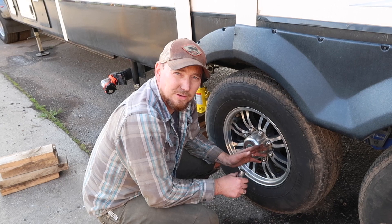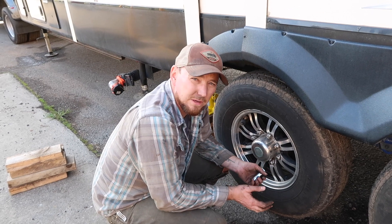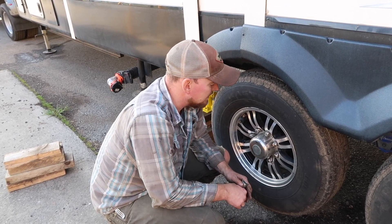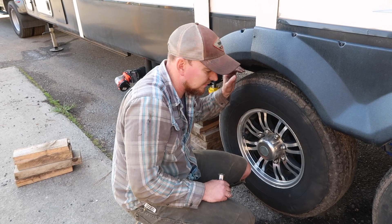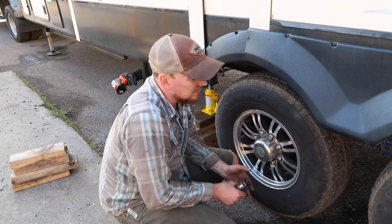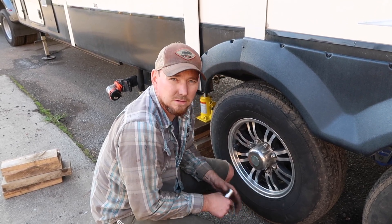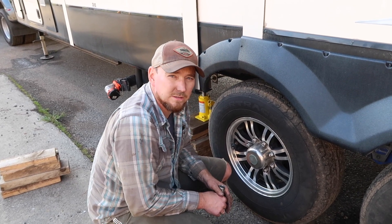Last step is to do a torque on the lug nuts. If you do them too tight, lug nuts can strip the studs and the wheels can come off — but obviously you don't want them too loose either. I've got a cheap torque wrench I got online for cases like this. Anyway, hope you guys enjoyed this installation. The reason I do this is hopefully it takes a little fear out of a project like this. It takes time, but it's just a matter of loosening things up and replacing with new bolts and nuts. Give it a shot — see you next time.